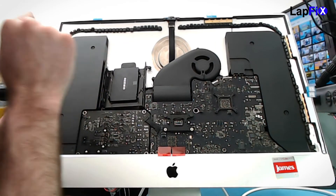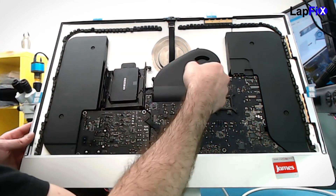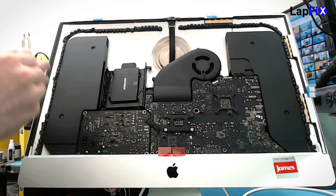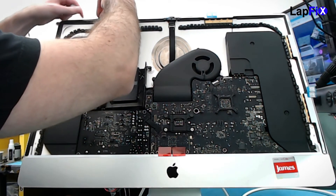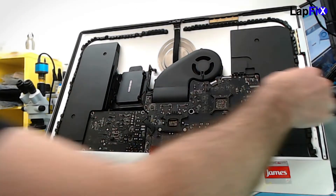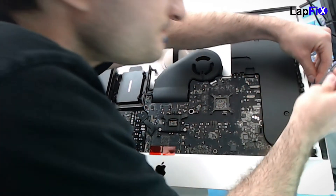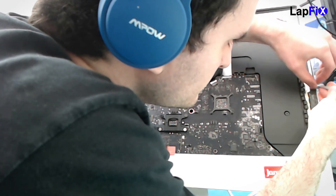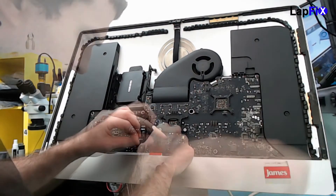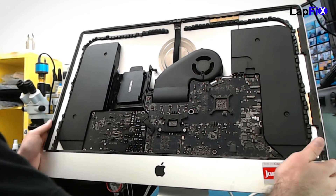There's the frame — now it's all adhered, looks nice. Since we have everything plugged in, I want to make sure the connections are connected before I fully put the screen down. I'm going to take off all the tape covers for the new adhesive, and then we want to test that the screen turns on before we fully commit to laying it flat.